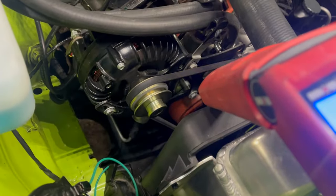This thing is bananas — this is a great combination. We're definitely in the neighborhood. Recall this plug was completely black before and now it's cleaning up. It would have been more ideal to start with fresh ones, but this tells me something. There's our timing line — that tells me currently we're safe and it probably could take a couple more degrees. We're really close. You'd have to go back to the first video in the series to see what the plug looked like when we started, but take my word for it: it was all black. Super black means rich — bunches of fuel, right? Keep in mind I've made no changes to the fueling at all, only to the distributor — re-curving and replacing it, then reattaching a vacuum line to run vacuum advance off manifold vacuum.